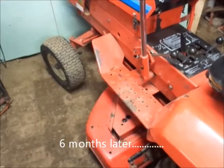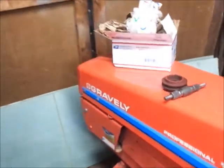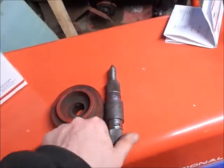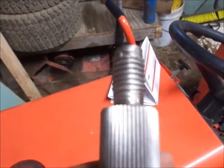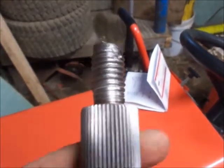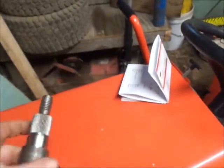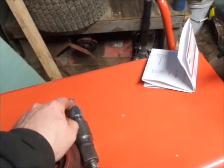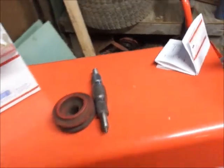I don't know if anybody remembers the 12G deck and the not-spinning-spindle-blade fiasco. So I ordered some parts off of eBay. I got another sheave or pulley — whatever you want to call it — and I got another shaft. The splines are really good up there. The threads down here are a little sketch, but I ran a nut up on them and the nut seems to go up on there okay. They look terrible and actually look worse on camera, but the nut seems to hold on there okay. Blade nuts are double a regular nut; I just ran a regular three-quarter coarse thread — maybe three-quarter ten — up on there.